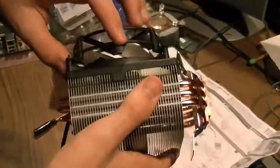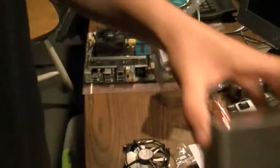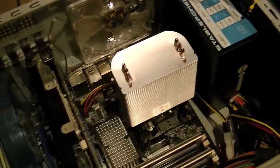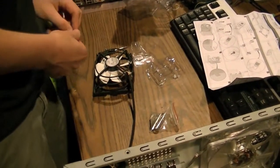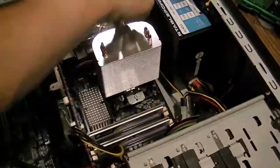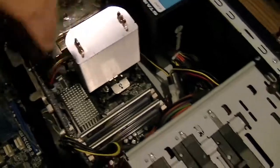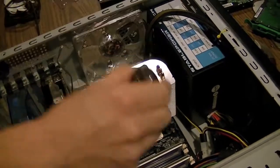To install it, you have to take the front fan off, and that's a pretty easy process. You just have to pull up this tab here and pop the front off, leaving just the heat sink, at which point that goes directly down on top of the mounting bracket. Then you take your screws and put them into each one of these holes, and get a screwdriver and screw these in. When you insert the CPU heat sink on top of the CPU, make sure you don't move it side to side — it might actually scrape off some of the compound onto the edges of the CPU and it'll get messy. Okay, and that's nice and firm.